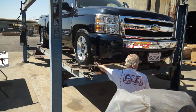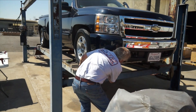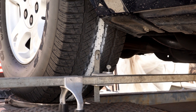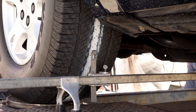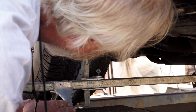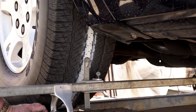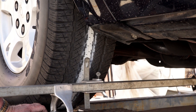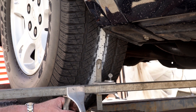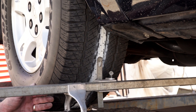Now we can carefully remove this and go to the back of the wheel — both the front and the back of the wheel are exactly the same. You may not want them exactly the same; you may want a little toe-in, which is pretty common. So you might want to adjust the front a sixteenth of an inch less than the back. It's stuff you can fool around with now that you see how simple it is.